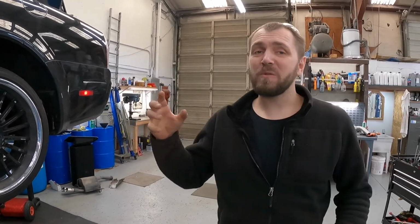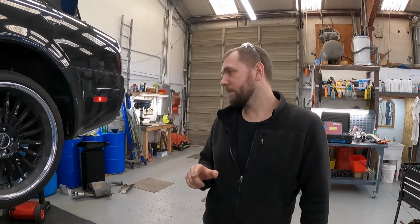and we have to finish that procedure because this is really important after bleeding. We don't know, maybe there's some bubble in the system, and the system adjusts by itself, like the fork, the shifting. They have two sensors, and those sensors remember the position of the gear and the shifting forks, and that's remembered for correcting shifting.